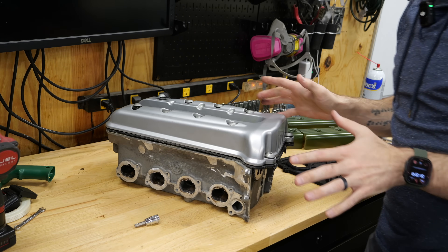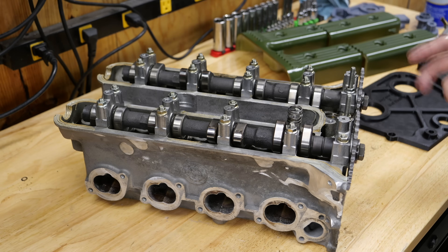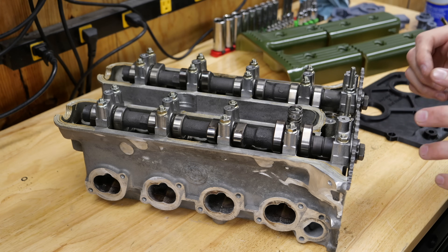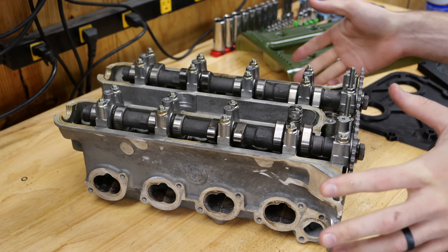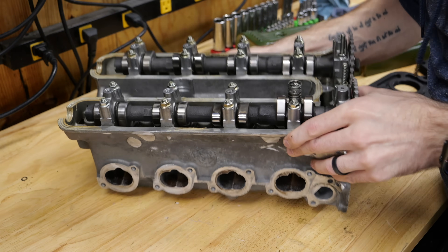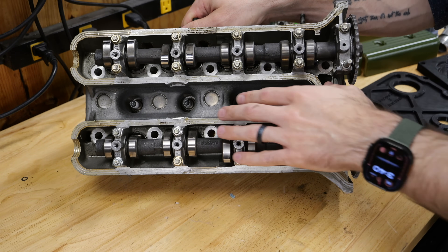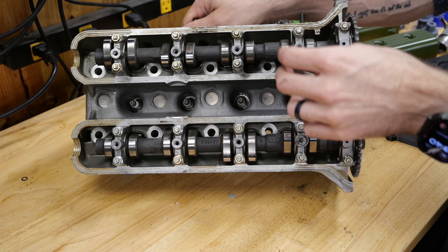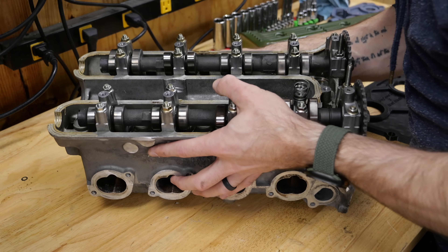Now let's take the top off — I want to show you guys the absolute beauty that is a dual overhead cam cylinder head. We're looking at what makes the cylinder head so special: two individual cams controlling the intake side and the exhaust side, meaning you have fine-toothed direct control of individual valves on each part of the engine stroke. One other thing you might notice is where the spark plugs are — those sit right down in the center of this cylinder head, which makes them really easy to service. For our build, we're going to be doing coil-on-plug, which means the ignition coil actually sits on each individual plug instead of having a separate coil pack like the old distributor setups did.